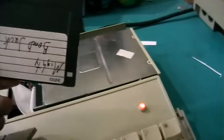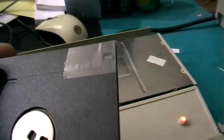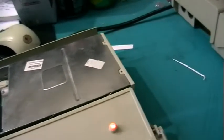You probably won't see it from the front, but on the back side you can see it. You have to put some sticky tape over the HD hole if you are using HD disks, or you will get read errors. At least I got some terrible read errors without doing that.